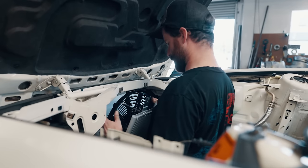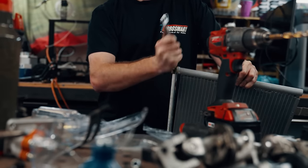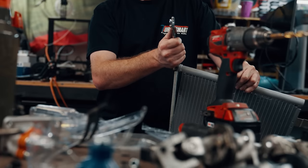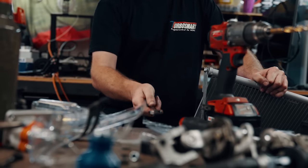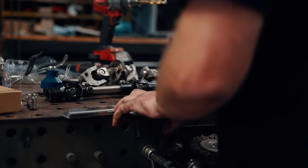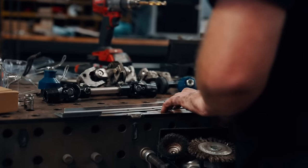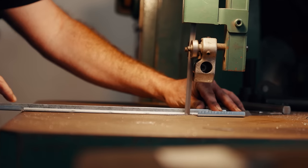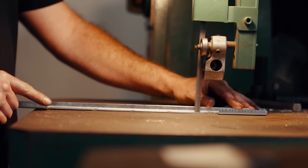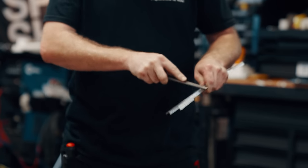While we're getting carried away, we might as well install an all-new AC system from AC Solutions and tuck a pusher fan in front of the AC condenser. AC Solutions sells a complete R134A conversion kit for 24-valve-swapped E30s. The parts are bolt-on so you don't have to cut them up, but since I want to mount the fan to the condenser itself, I'm making some slight modifications so it all tucks into place nicely.